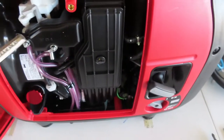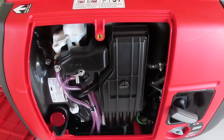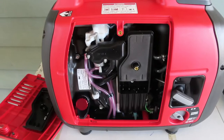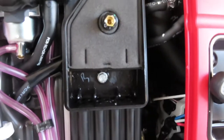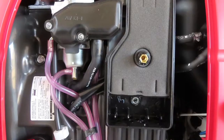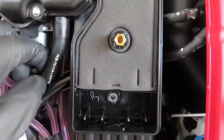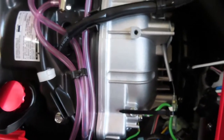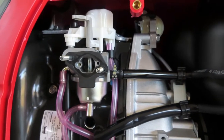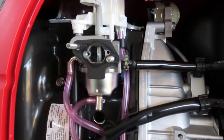The cover is off. Next we need to remove that screw and then these two nuts to get the air cleaner housing off. Once the air cleaner housing is off, pull up the little pre-filter, and there's one more bolt right there that needs to come out. Now all those bolts are loose, and there is one more hose right here holding the air cleaner on.